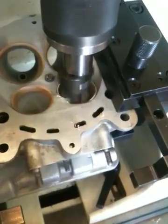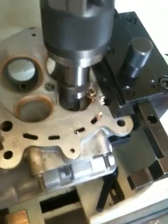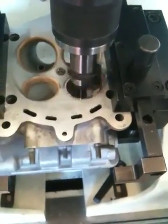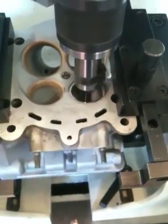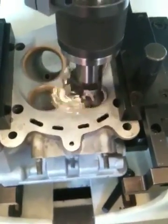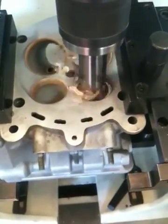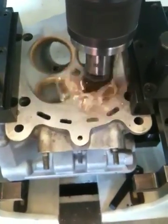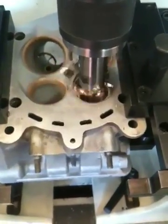The thing you've got to remember — these are beryllium seats. I have a mask on right now. Beryllium is a very toxic material. You don't want to turn it into a dust or particulate matter and breathe it in. It's very hazardous. Don't recommend anybody grinding it — don't try porting your heads with a grinder. Turning it into that fine of a particulate matter would be very, very bad. In chip form, it's kind of hard to get large chips like this down into your lungs. So it's just a precaution you need to be careful with whenever you're messing with any type of high-performance cylinder heads.